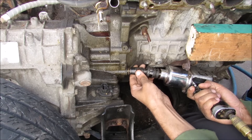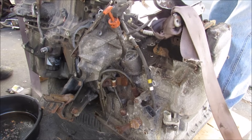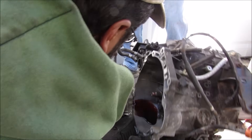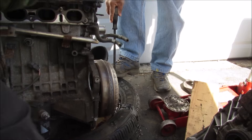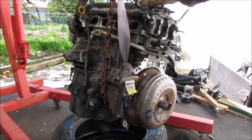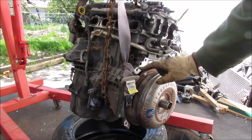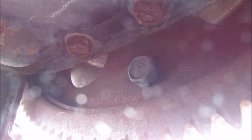I'm going to remove the 14mm bolts at the back of the engine. I've got the engine and transmission disconnected. With the engine unbolted from the transmission we have here the torque converter which is bolted to the flywheel. I need to remove that next — so underneath the engine where the access cover is there are a couple of 12mm bolts that I need to remove from the flywheel.